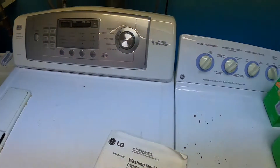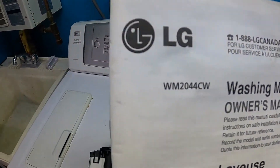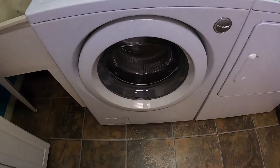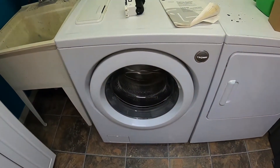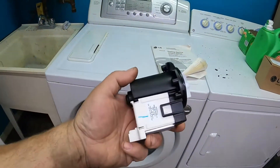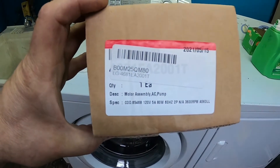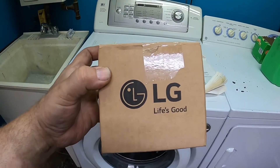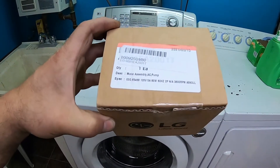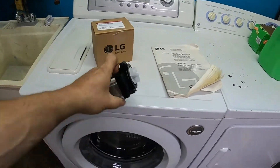Changing it up a little bit today — doing a waste pump, water pump, for an LG WM2044CW front load washing machine. The washing machine will not empty the drum; it's very loud. We're going to change the pump. I picked this up off Amazon; it's a genuine LG pump and there are the part numbers. It's a bit pricey but it was about $80-something dollars here in Canada delivered. They do offer some aftermarket ones but there's a lot of negative feedback that they don't last very long.